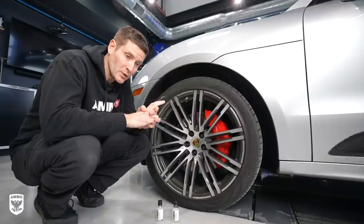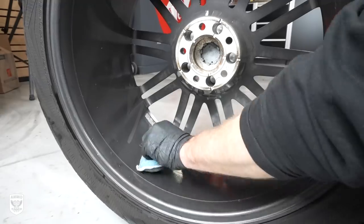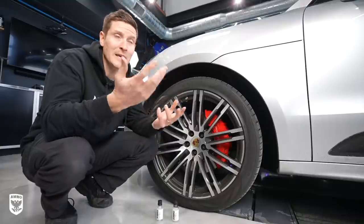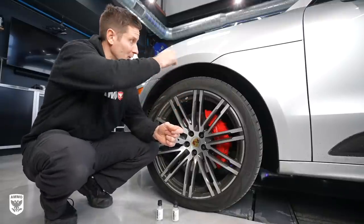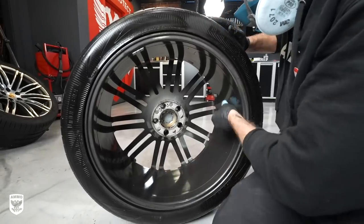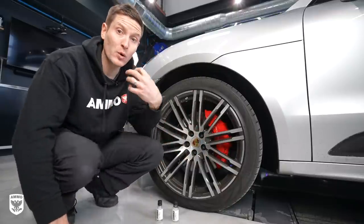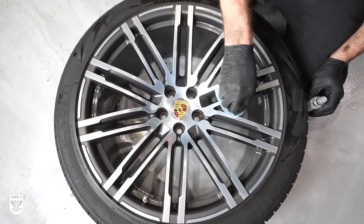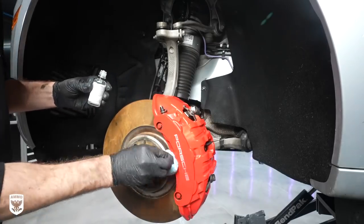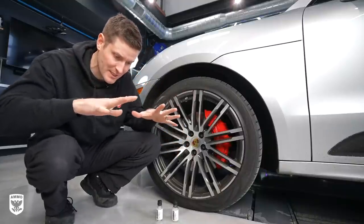Option number two is a little bit trickier, but you will get a bit more life out of it. In this case, let's pretend we take the wheel off and we're applying it on the back side. You can apply it in very long strokes, as if you were painting a wall. You don't want to have streaks — if you leave streaks in there, it is going to stay. So take your microfiber applicator and just gently flow it out. The idea is not to put a lot on there — you want to put thin layers, but you're not going to buff it off. Same thing with the caliper: you want to get in everything, not a lot. You're not fire hosing it on — you want to gently put it on, let it sit, and you'll see it kind of settle down. You're good to go.